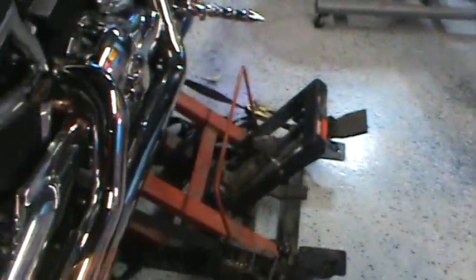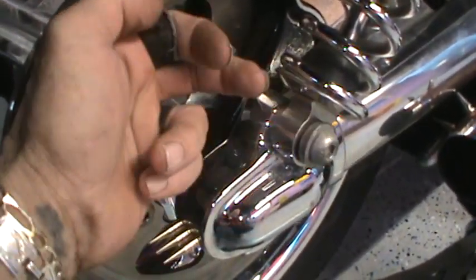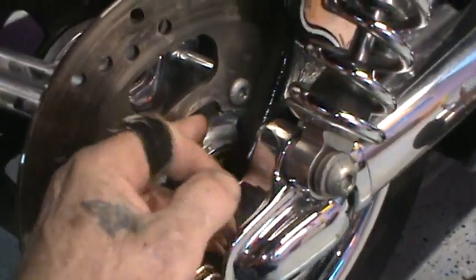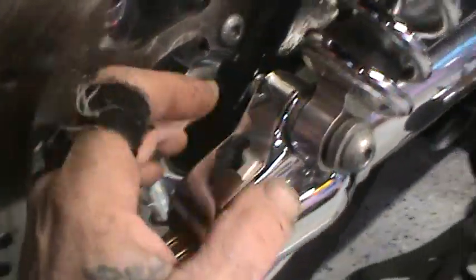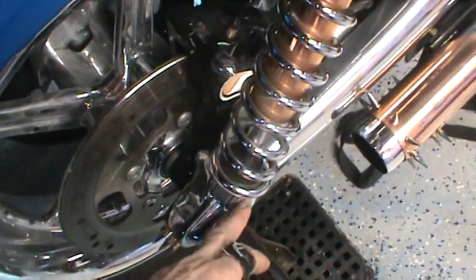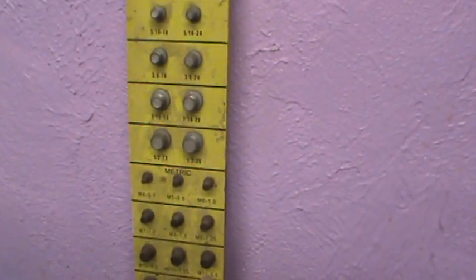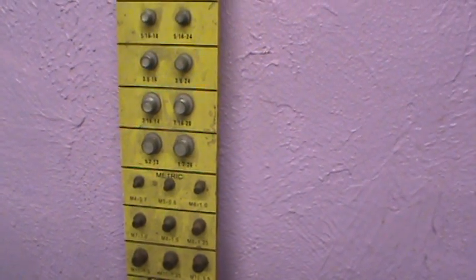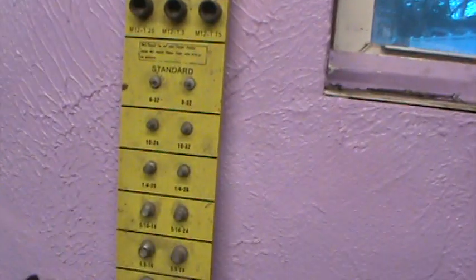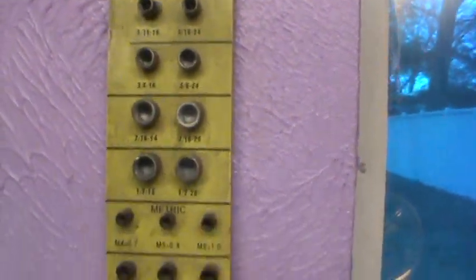You have to drop this rear rim in order to slide the bolt through this way, because you can't get it past that right there — the brake housing. These bolts, I think those are M10 times 1.5 thread pattern, and I couldn't find spikes for them so I had to buy half inch, 13 thread. These thread gauge tools are priceless because you never know what thread is which — about 45 bucks.